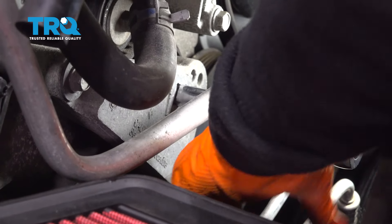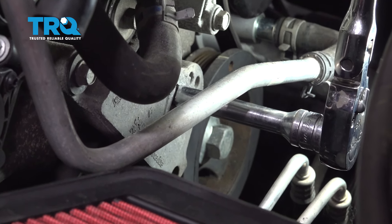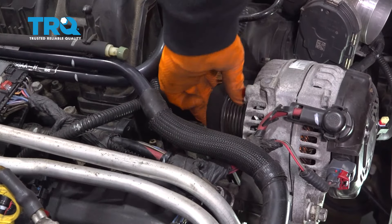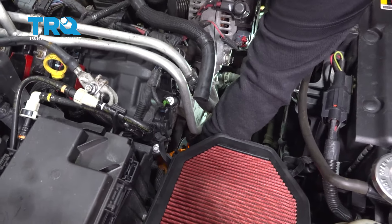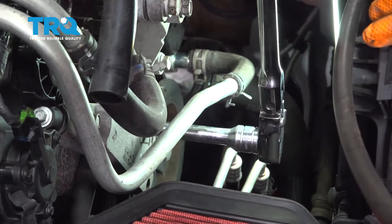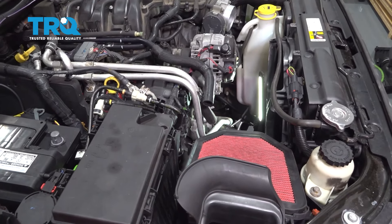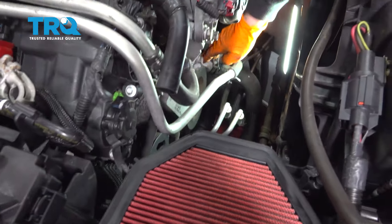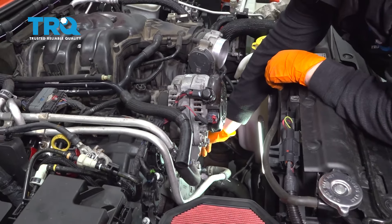To put the serpentine belt back on, get a half-inch drive with a little extension on the ratchet and push down slowly so the shock goes down. Once it's bottomed out, reach back and grab the belt and put it right over the pulley. Double-check the rest of them — I slipped right off the power steering. Let up on the tensioner and that hydraulic pressure and shock will seat it right back. Give it a quick visual: follow the belt around — right in the idler pulley, power steering pulley, harmonic balancer, and don't forget the AC. Belt is seated — ready to roll.